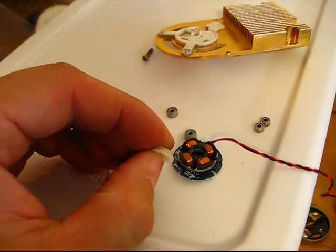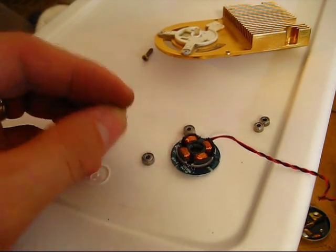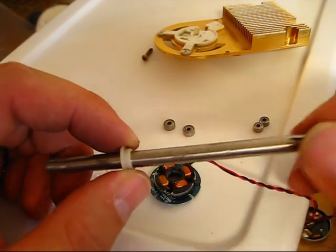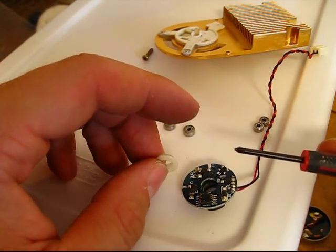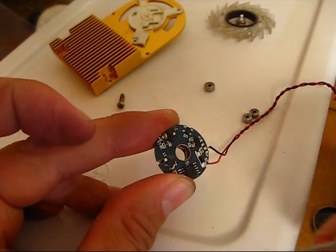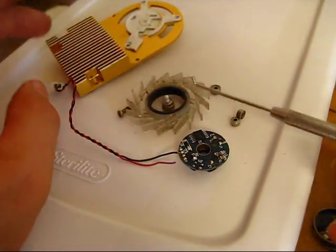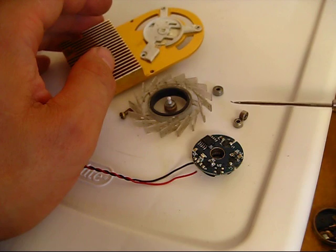I found two little plastic, probably nylon, bushings — they are 6mm on the inside diameter, so my bearings will fit right in there. I'm going to put them on some smooth shafting and work down the outside diameter so I can get the glue in place. Actually, I ended up abandoning the plastic bushings and found some bronze bushings instead. I'll get the diameter down just right, Loctite them in, and then epoxy the broken part back onto the heat sink. One of the wires got broken off while working on it, but then I can put it all together.